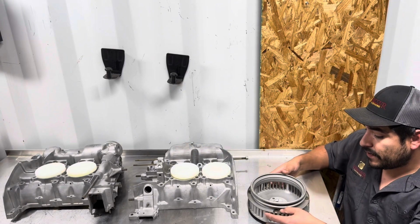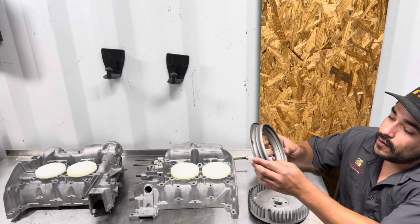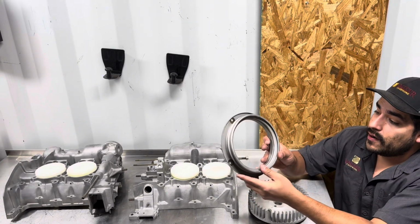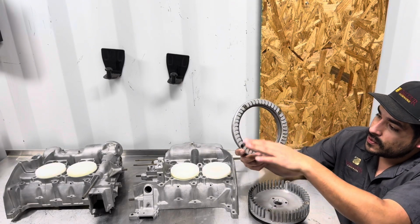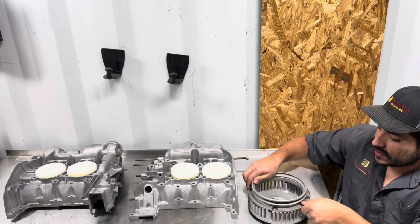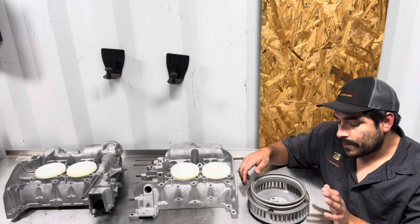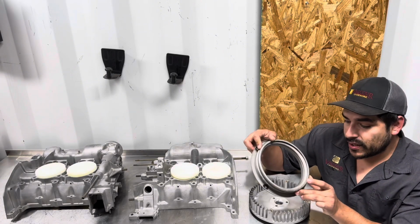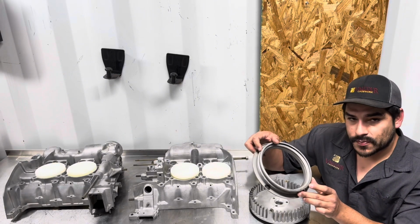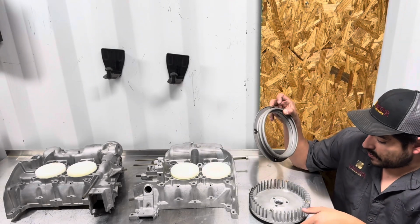This fan itself has been hit with aluminum oxide. You can see right here on the edges of the lip where that was what it originally looked like. This part is actually steel, so you can see where we weren't able to get it because it was touching this end. This part has already been harmonically balanced. You can see here by the brass weight, which makes vapor blasting a really good solution to cleaning this part, since it's not going to remove material, even on soft materials like the brass.